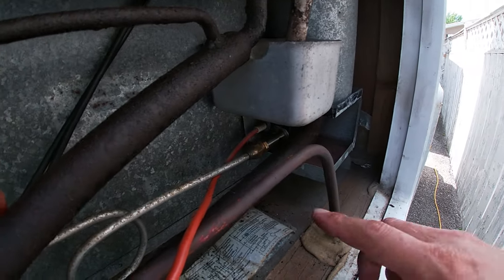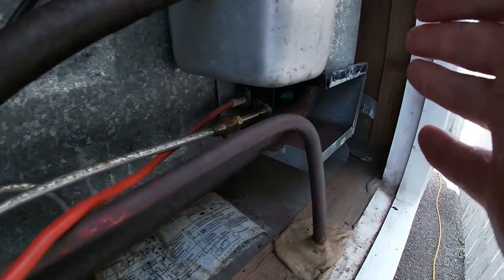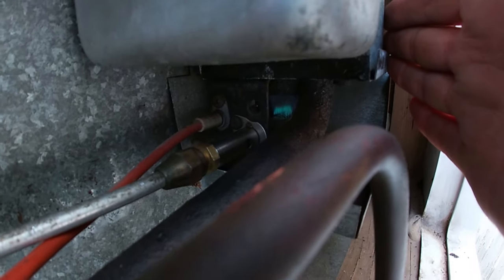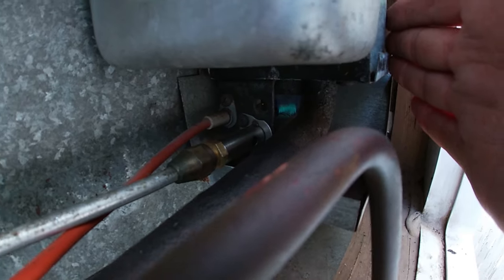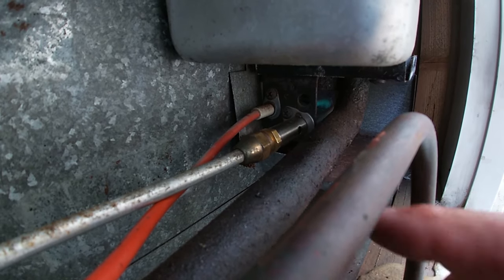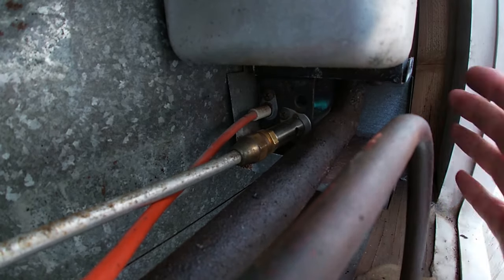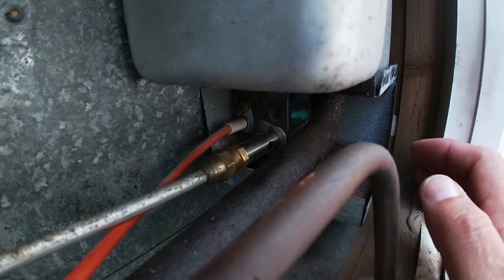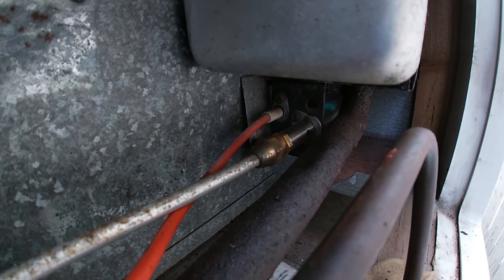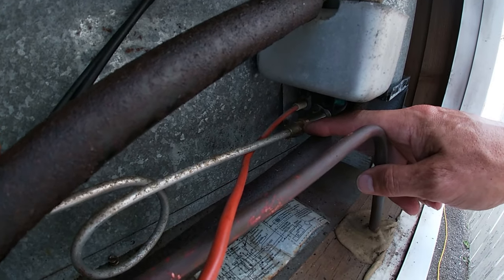What I would recommend is install this yourself if you want to, and then drive your RV over to a heating and air conditioning company and ask them to do a leak test on that fitting right there. Because you're going to take this off to change that nozzle — anybody can change the nozzle, you can do this yourself. It's simply a Phillips screwdriver for the cover screw and then this simple nut. That's all it is. But because you've had this off, now you need to take it in and get it leak tested.